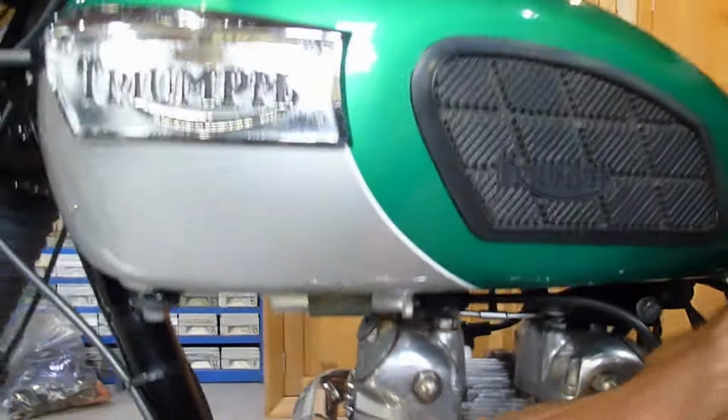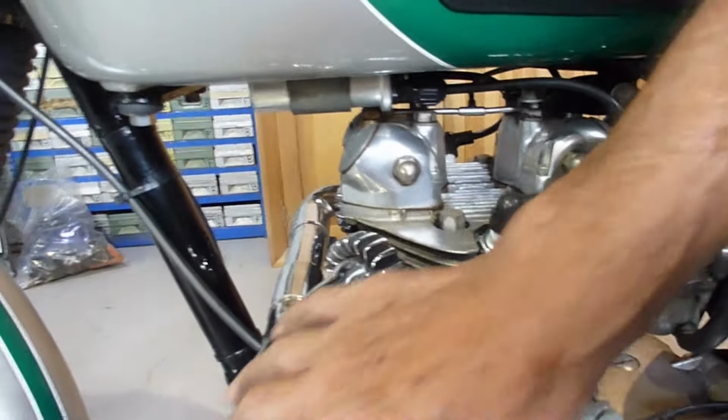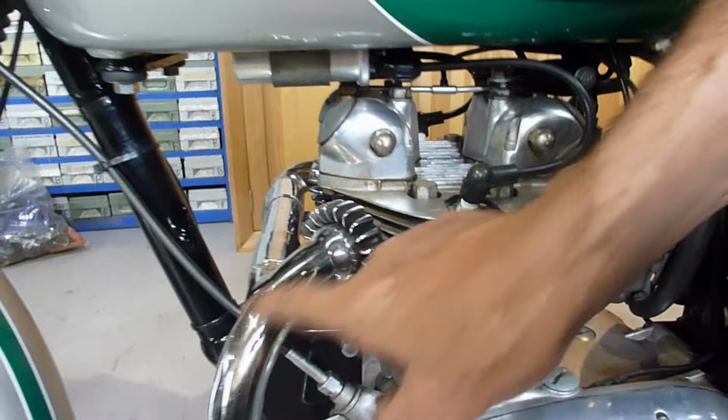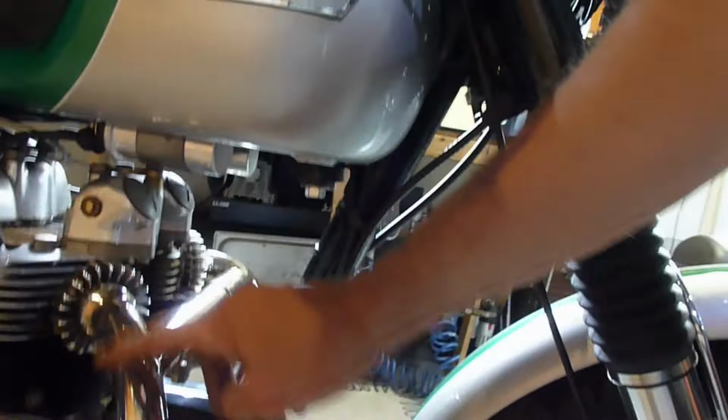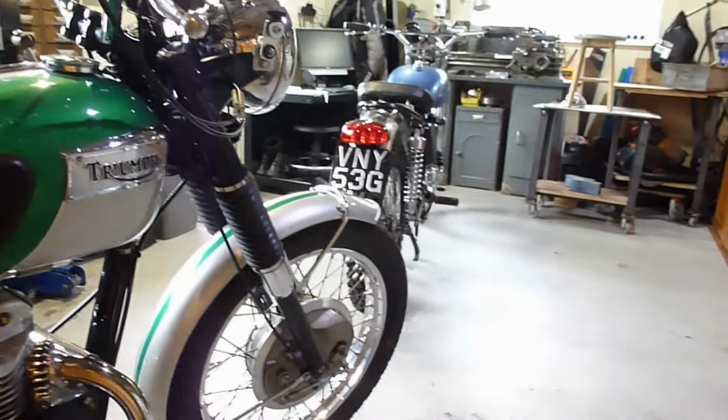However, on overrun, and then when you just bring the throttle back slowly, it just seems to be a little bit more on one cylinder than the other. Saying that, I've got hardly any discoloration, and I have given it a good thrashing. It's very slight, a light straw or something is coming there.